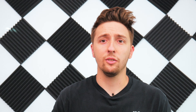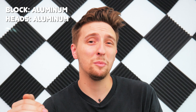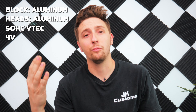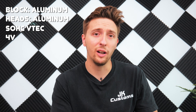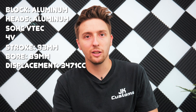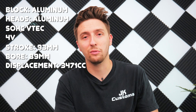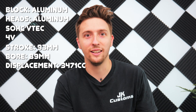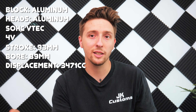The J35 is one of the most popular engines in the J-series family and for the most part the types of vehicles you'll find it in are Honda's larger vehicles — large sedans like the Accord, minivans like the Odyssey, and their trucks like the Ridgeline. It's an aluminum block engine with an aluminum cylinder head, single overhead cam with four valves per cylinder, and VTEC variable valve timing. Cylinder bore measures at 89mm with a stroke of 93mm, making the J35 a little bit undersquare, which is more conducive to producing more low-end torque rather than high-rpm power — a good thing for sedans and minivans where you don't want to be revving to 9,000 rpm going from stoplight to stoplight.